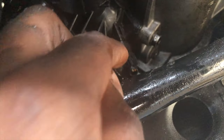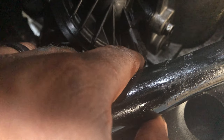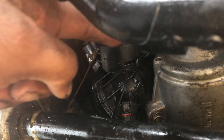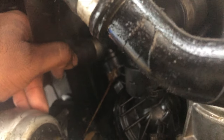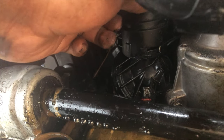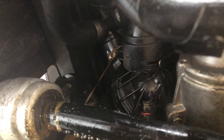After that I'm going to go ahead and remove these clips right here. Now I can use a flathead or something flat to pry over here, lift it up, and pull out the thermostat connector. I just took this clip off the thermostat — so both of these, you just use a flathead, pop up the clips, and pull them. I pulled the smallest one — that was the easiest one. Now I have to do this big one, which is a pain in the butt. Pretty much all you got to do is wiggle back and forth, shaking and pulling straight back. Make sure it's straight back and it'll come right out.